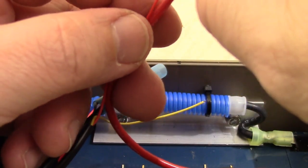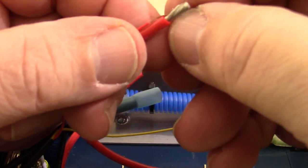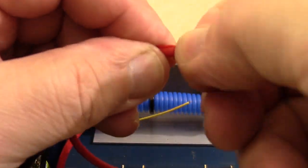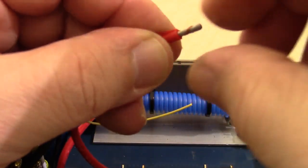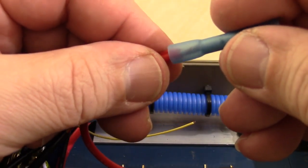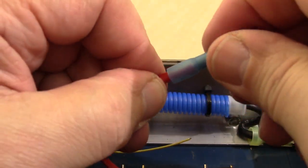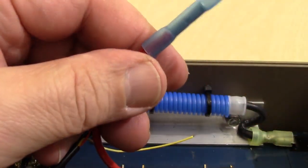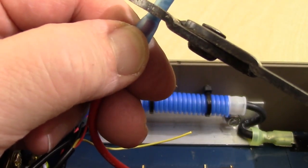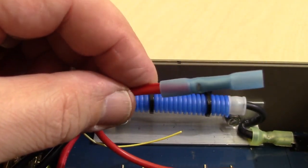And we are going to wrap this around here a little bit. Bring it right up so where it's level. Two wires, jackets meet. Wind it around. Take our blue butt connector. Put that in there like that. Twist it in till we get to the jackets. Crimp it down. It's going to look like that.